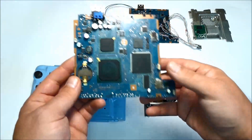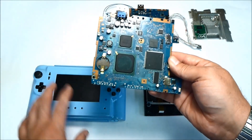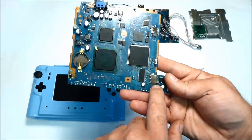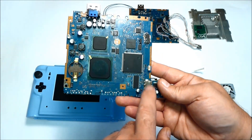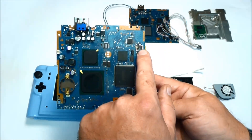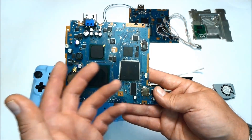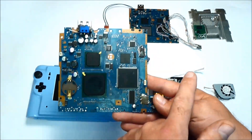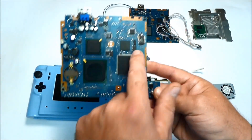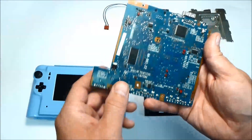Let me show you my old dead motherboard. It's from a PS2 Slim — I trimmed it to make sure it would fit in the case, and also removed a couple connectors for the DVD drive ribbon cables. Those connectors were quite hard to remove, especially the 24-pin connector where the pins are so close together. You have to remove it without damaging it because you'll need to extend the wires and reconnect them. The 12-pin connector is a bit easier.